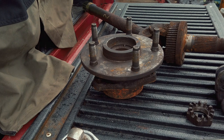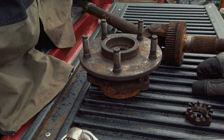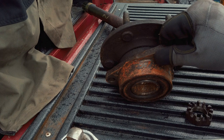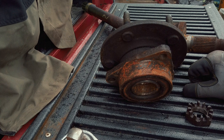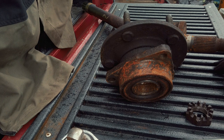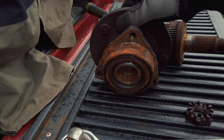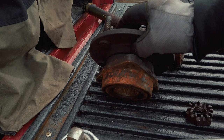Some people don't realize that's the sealed wheel bearing they're banging on. I was able to get it out using the method of cranking the bolts out, putting a deep well socket and extension on there, starting the truck, and turning the power steering — it comes back against the frame and pops the hub. We also used a hub puller. Got to be careful with your power steering, but that method works.